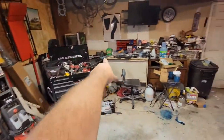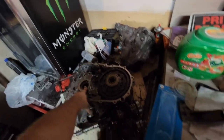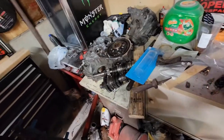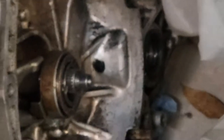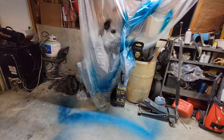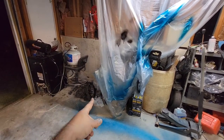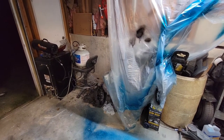This is the GSR 5-speed. I figured out what's wrong with the locked-up transmission — it was a bad input shaft bearing right there. I took it apart for now, get it fixed, put it together, put it on the shelf. That one's got a hole in the case — I'm gonna take it apart, figure out why it's got a hole in the case. If nothing caused it besides the clutch going bad, we will get that welded up. We're not gonna replace the case — we can get it welded up and just check through everything, rebuild what's necessary, or go ahead and put in a full synchro kit. We have another GSR as well.